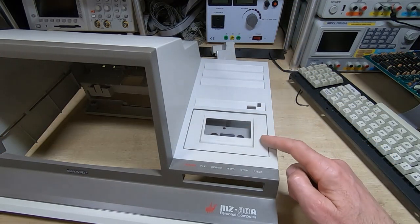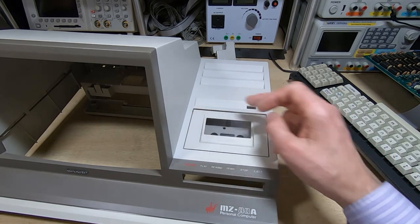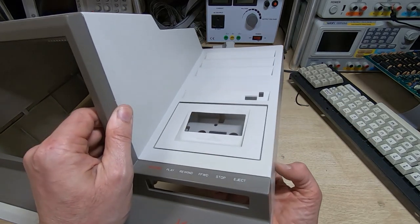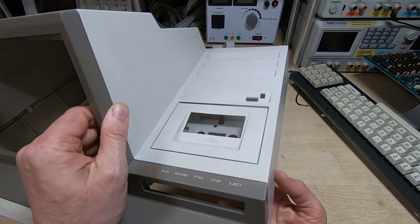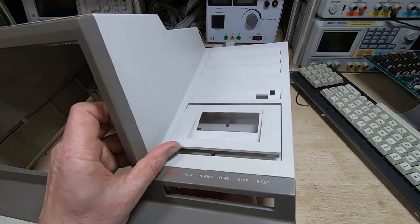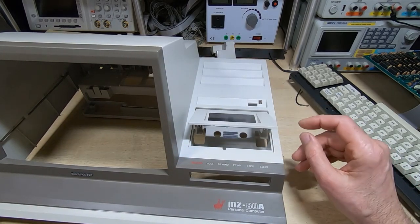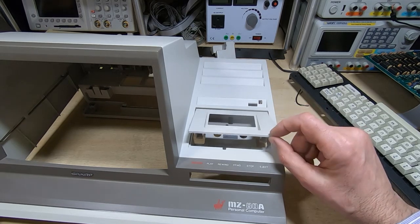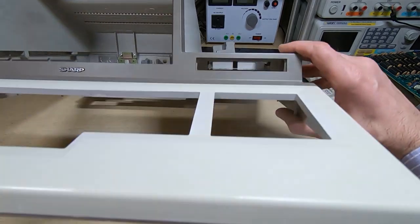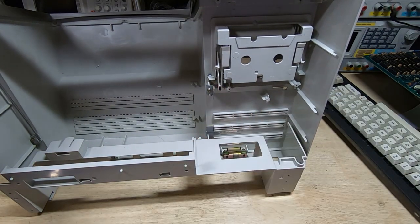That's the door refitted — I've refitted the spring, the bracket, and the screw; it all lines up properly so the pin is in the right place. What I'm trying to do is make sure it's got an over-center action, so as you open it, it pops open and stays open, and then when you close it it should snap shut — which it does. Let's turn it over so you can see the inside, and then we can reunite the top cover with the main chassis.